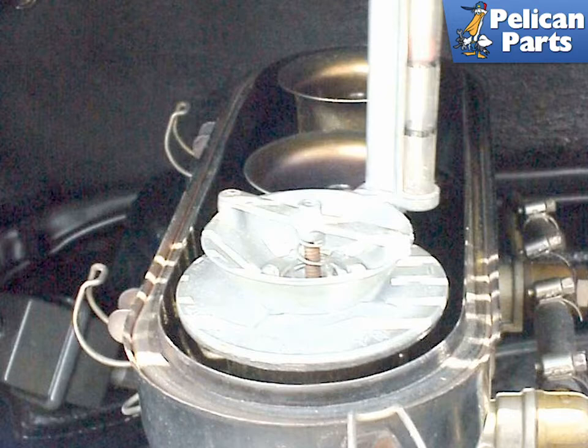The Unison Synchronizer is a very useful tool for balancing your carburetors. Make sure that it completely covers the top of your carburetor or the velocity stack when taking measurements. Once you have the synchronizer set for a particular cylinder, don't change the diaphragm setting until you are finished checking all of the other cylinders.